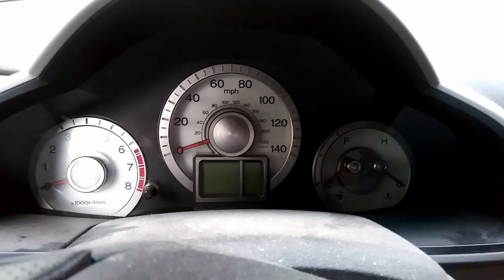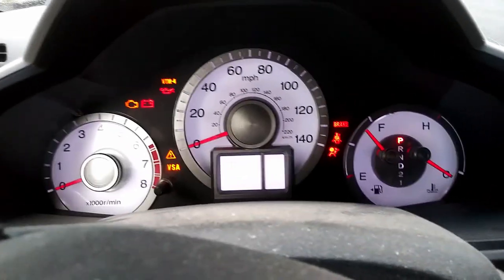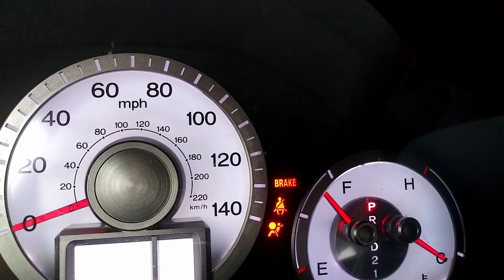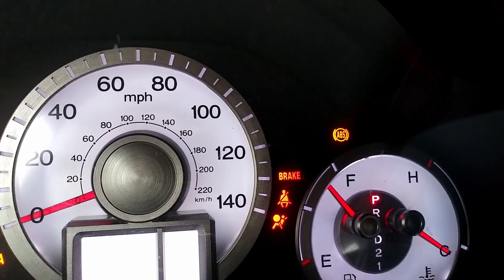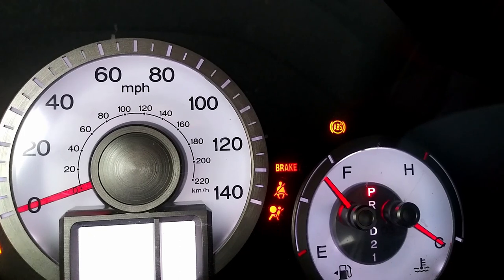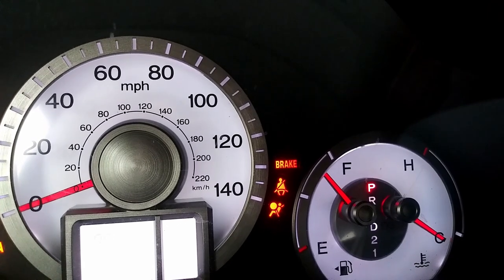Now here we are. We're going to put the key in the ignition and take a look for that ABS light. You saw that ABS light went off, but now it's back on and it's blinking. This is the really important part — to read that blinking. It's long and short, so it's doing some codes. Here's: pause, one long, then one, two, three, four, five short — so that's 15. Then one, two, three, four, five, six, one short — so 61. That means the ABS system is throwing codes 15 and 61.